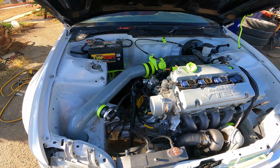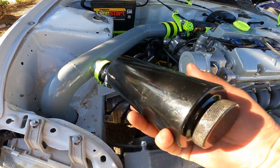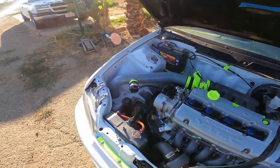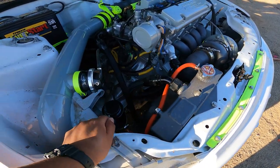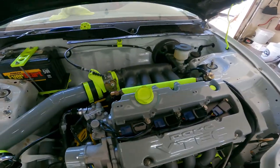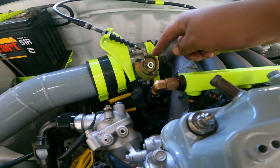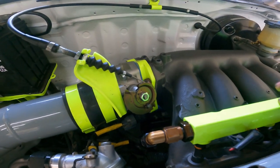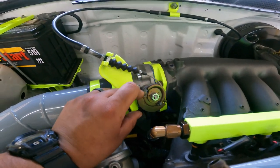I've got a coolant reservoir off Amazon — about 20 bucks, just a reservoir, nothing fancy. Got the car running and coolant reservoir installed. The hose is ugly so I'll get a black one, but it's just what came with it. Huge shout out to Brian — he had a GSR throttle body and sold me just the pulley. It wasn't a quite direct fit; this portion was slightly bigger than the GSR one so I drilled it out enough for it to slide through. The spring fits fine and now the throttle returns just the way it needs to.